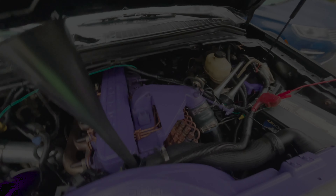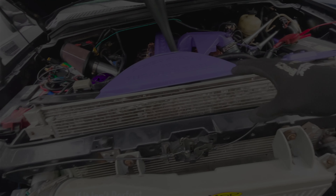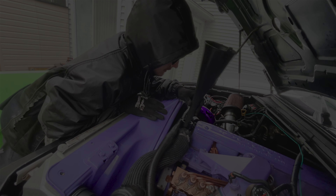So, this being a swapped truck, there's no bottle or reservoir for the actual radiator coolant. A 12-valve Cummins with a Cummins radiator — this being a Ford 6.4 liter PowerStroke radiator — what do you notice? There's no cap to fill it anywhere. So we had to cut one in, into our hose. It should fill either way, thanks to gravity.